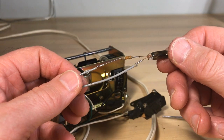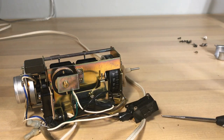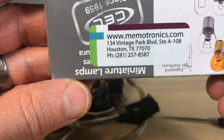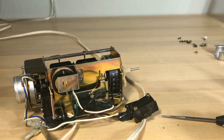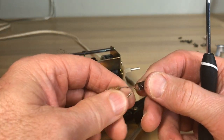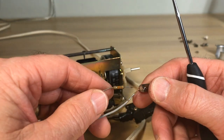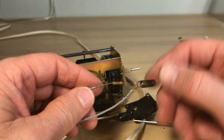You slide the tubes down — they go far enough away from the bulb to where it won't get in my way, so I'll be able to replace just this bulb. You'll see the resistor there; the bulb you replace it with has to have a resistor. The bulbs I typically use are called C2A, and I use the company memotronics.com. They include the resistors you need with the bulb. You don't want to use the same old resistor — they've aged and won't function as well. So you want to replace the bulb and the resistor. We want to get the length about the same as this setup so we don't have to cut wires.